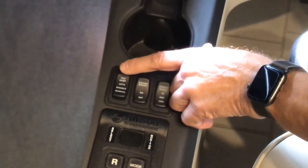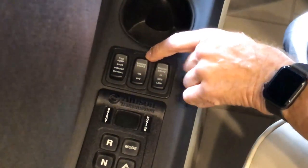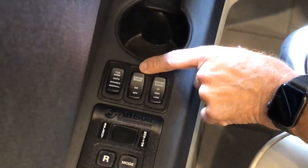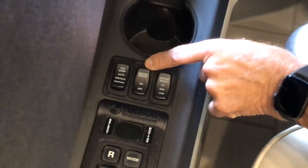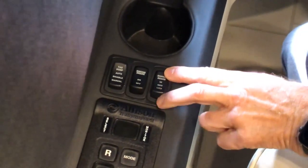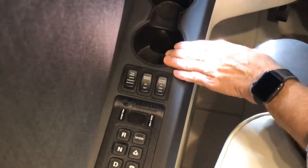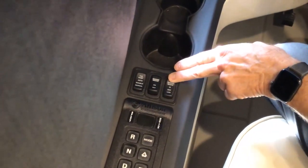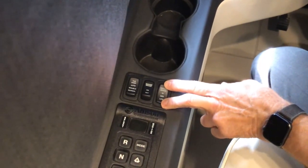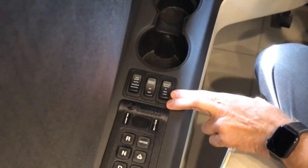Just to the right of the tag dump is your engine brake. This is an assist feature so that when you release your accelerator pedal with it engaged, you can adjust the amount of braking from your engine exhaust. If you're in the mountains on steep inclines, turn this on and set to low, medium, or high — it helps save your brakes by using engine exhaust to slow you down. If you're driving at slow speeds with no inclines, you might want to leave it off.